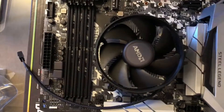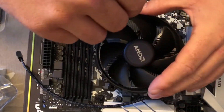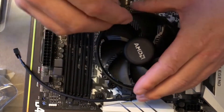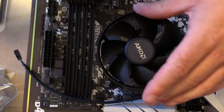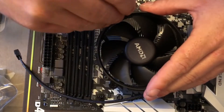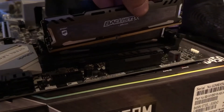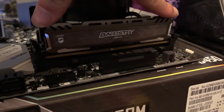If you're just using the Ryzen stock cooler, you can go ahead and fit that now — it's not going to get in the way of installing your RAM or anything; some of the others might, so just bear that in mind. To secure it down there's just four screws, one on either corner. You can't really go wrong — just tighten them up till the screws stop, but do it in a cross formation so you get even distribution on both sides.